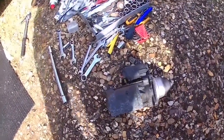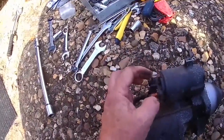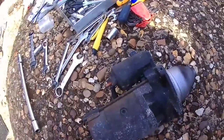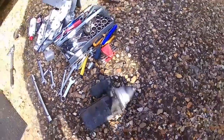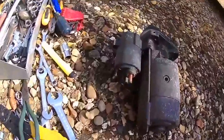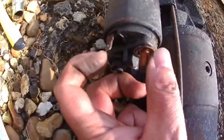I've noticed there's a different electrical connection here. This is a spade-type connection, and on the other one it's an eyelet. So I'm going to cut the spade off and put an eyelet on the end of the cable so it fits on the new starter motor. The electrical connection on the old one has a flat spade connector, and the new one has an eyelet, so I'll put an eyelet on the wire.